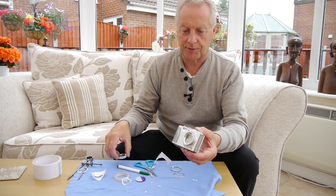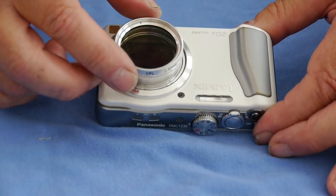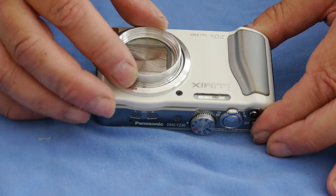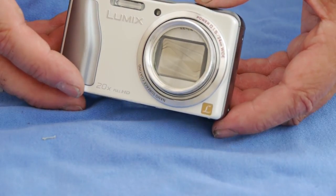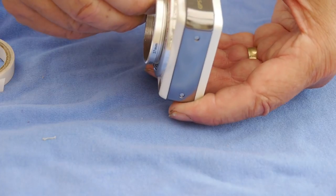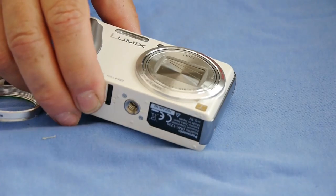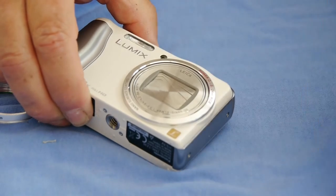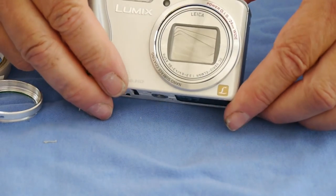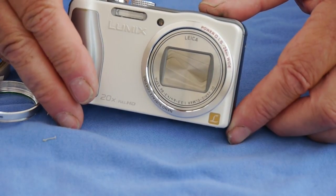Once that's cured you have the mount for your additional 37mm filters. That's the method I used to fasten the 37mm filter to the front edge of the camera using double-sided adhesive tape. When you want to remove the filter ring — for example if you're going to resell your camera — just put your fingernail between the filter and the lens and give the filter holder a gentle twist and it will come off without causing any damage. If there's any residual adhesive on the front surface of the lens plate, just give that a wipe and it will come off cleanly. That's my method of attaching the 37mm filter ring to the travel zoom camera. Hope you found that interesting — it's Graham, thanks for watching and hope to see you in later videos.